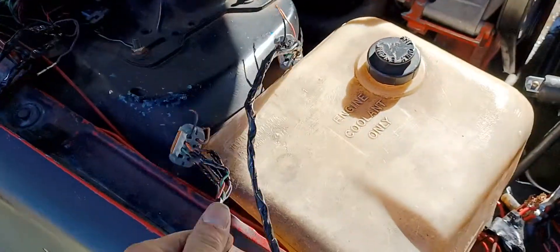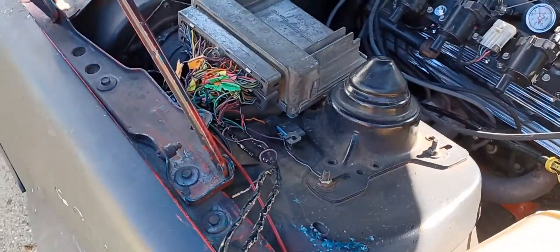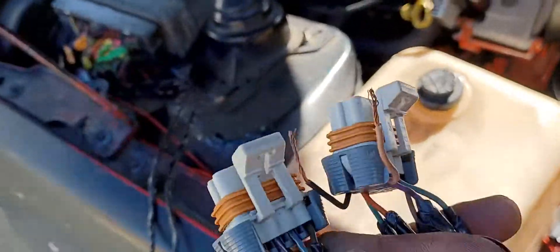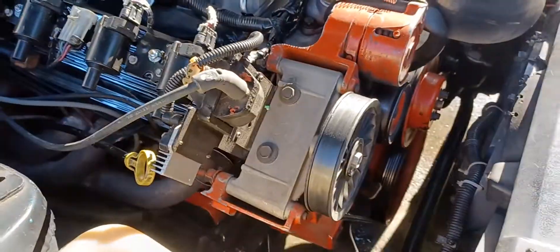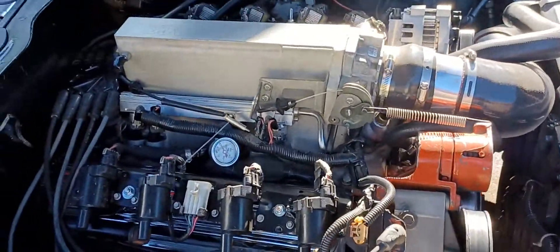About the distributor — I already bought it. Made the harnesses with the coils, got them wired in already. You can see power and ground — that's about it. I still need to rewire the camshaft position and crankshaft position sensors and give it a tune. Pop in the 24-tooth reluctor wheel and we'll be in business.